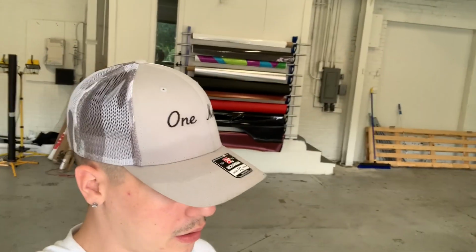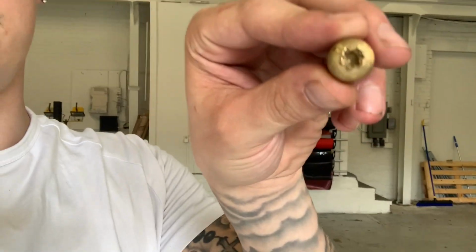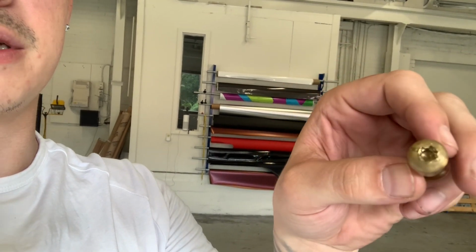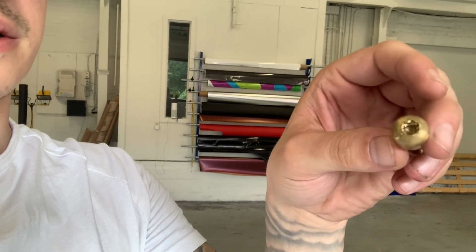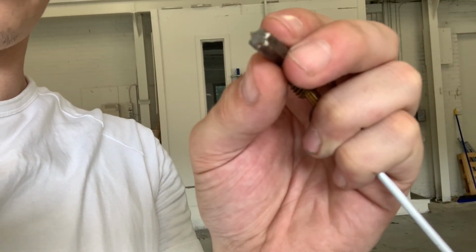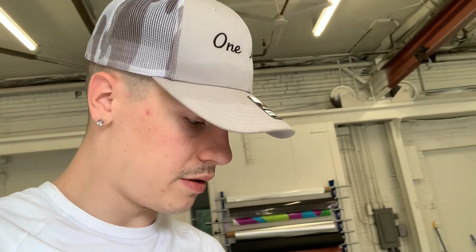So guys, this is why I changed my dipstick. For one, with the RIP dipstick, you can use sockets on it. This is what happens when you do a few oil changes. Maybe you tightened it too much, maybe the elements changed a bit, so it got a little stuck. What I had to do was take an oversized Torx, bang it on there, and luckily it came off, so I didn't have to do any drilling, which would have been terrible. So that was on the dipstick.